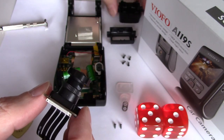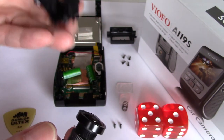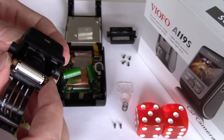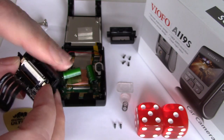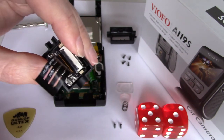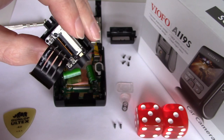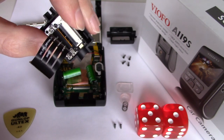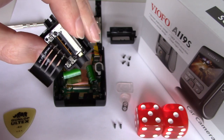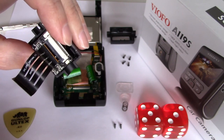I've reduced the gap and now I can see the line. You would now reassemble all the components, going over one more time to make sure the screws are tight. Get your housing cowling again, matching the left notch, then reassemble and do some test footage. If you see that it has improved on the left and you want to do it slightly more, you can take it apart and do another test video until you get it in the right position.